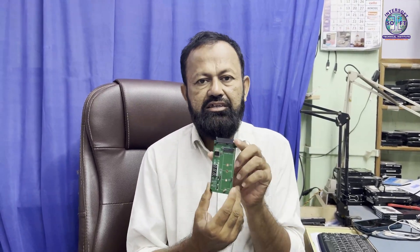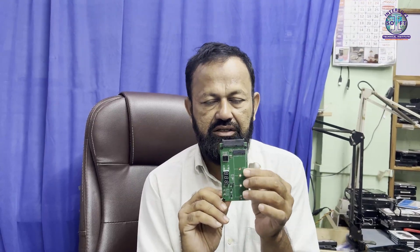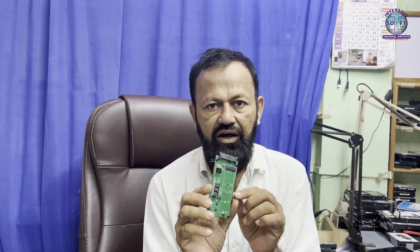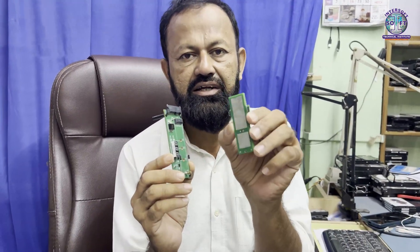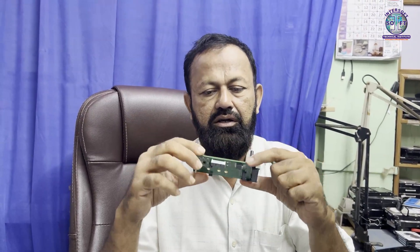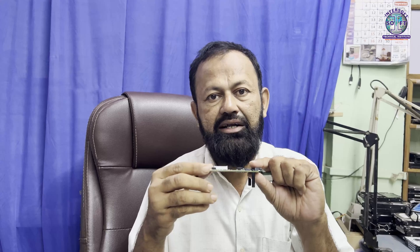Welcome friends, today we will explain about the MRT product. MRT introduced this conversion for NVMe SSD. This device comes with chips and also a heater for the NVMe temperature controller, to heat the NVMe. This is used for the PC 3000 Portable but we are also using this with the MRT tool for some NVMe SSDs to load LDR and do other things with this controller.